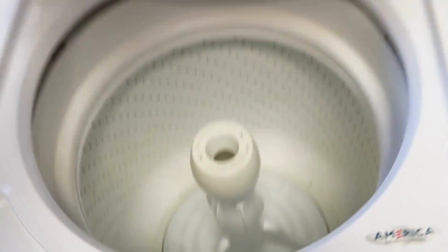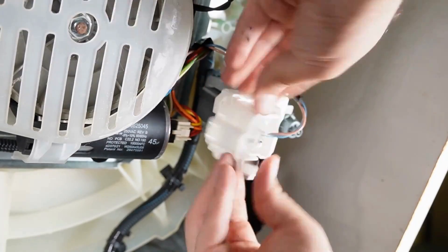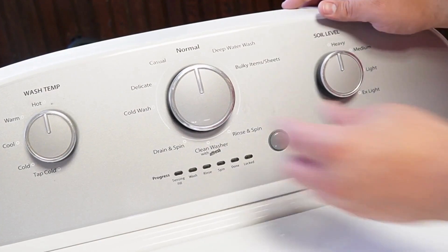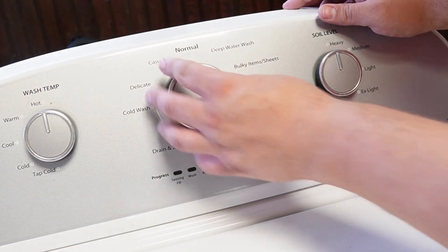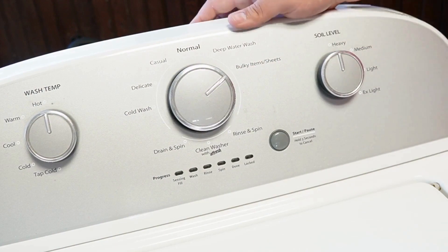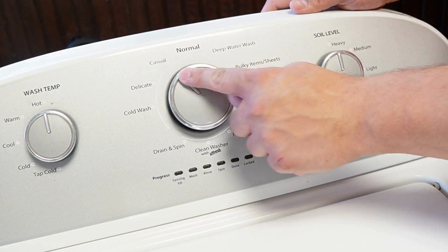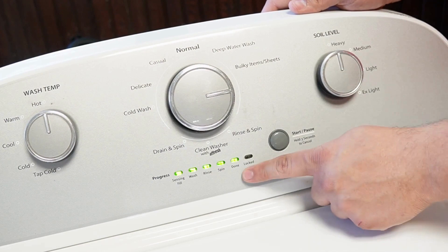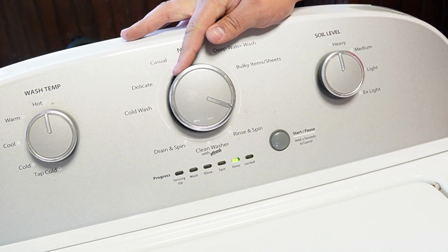Now that we've done the first reset, let's attempt to recalibrate this washing machine through the calibration mode. This is a must-do if you've installed any new parts on the washing machine — from a board to a balancing rod. With the washing machine freshly rebooted, rotate the dial again counterclockwise 360 degrees. Then turn the knob right three clicks, left once, then right once again. You need to do all these things within three seconds, and it may take a few attempts, but if done right all the lights at the bottom of the washing machine control should flash on and off, showing that you've entered into the diagnostic mode.